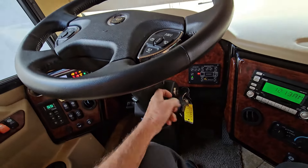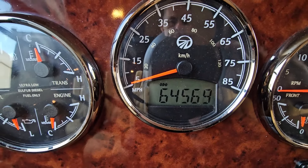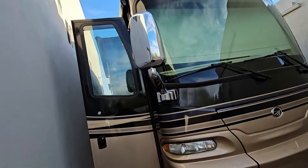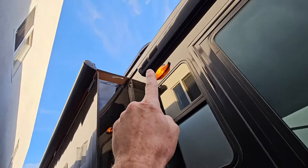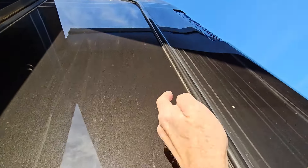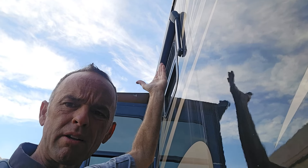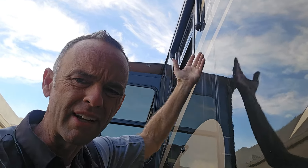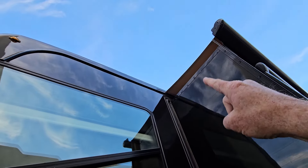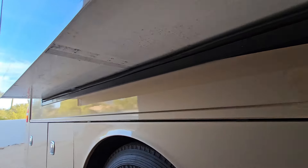These also have a very unique steering column with the ignition switch on the column itself. It looks like we're at 64,000 miles. I want to remind you this is a Monaco product — we do want to check the roof radius at this molding right here to make sure it hasn't broken loose. This molding and the hardware that secures it, especially at the roof cap, likes to separate from the sidewall, letting moisture and water in and causing issues. It's most common right where the slide-out topper meets because of the tension from the topper itself. We're also going to check all the slide-out seals.